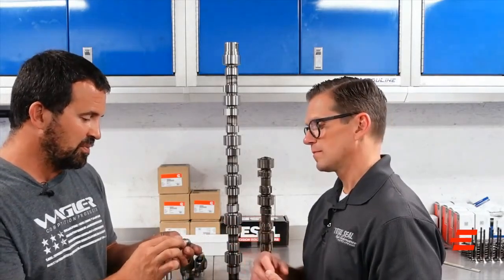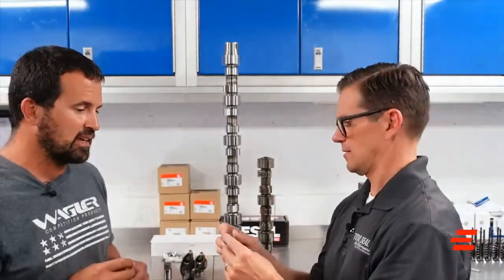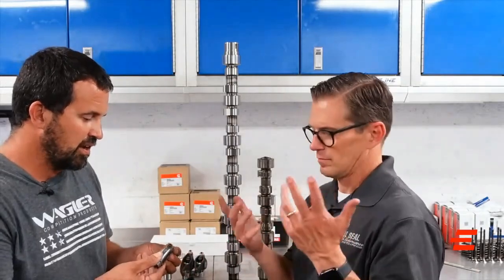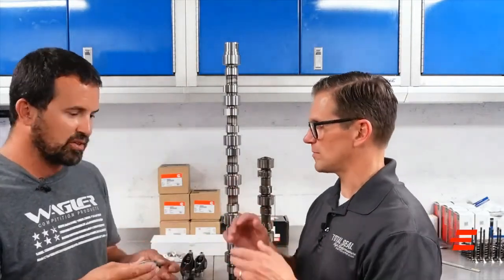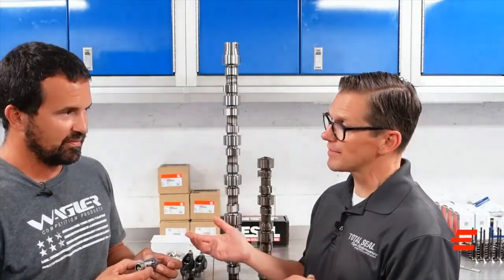A lot of dealers were dismissing the complaints. Not only is this lifter kind of walking around, there's actually slack and slop because the axle is free-floating — it's loose in the body as well. I feel like it's a design flaw. The oil pressure situation with really thin oil — zero-W30s versus the traditional 15W-40 that it always was — for emissions and fuel economy they've gone to lower viscosity oils, and that may be one reason they went away from the flat tappet to the roller.